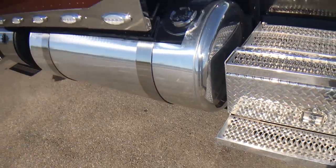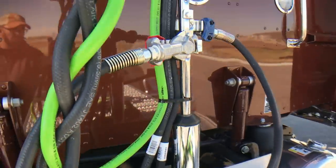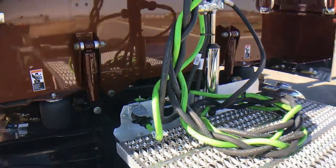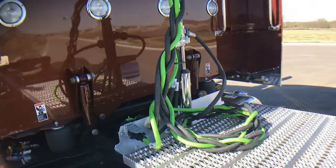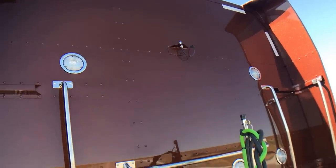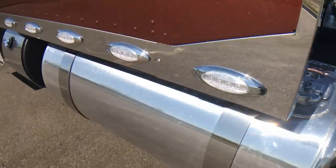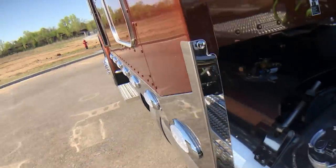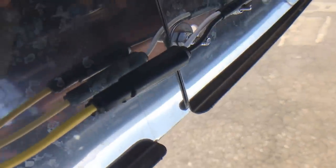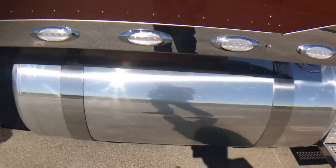This tank is 120 on this side. One of those little things we do: chrome the pogo stick. Dual seven-ways. We've got straight lines on this truck; if you prefer the curly lines we'd be more than happy to swap them out. Six lights in the rear with the antenna moved to the back. It's got the Phoenix LED light kit. As I do all my trucks, it's on a factory harness with all weather-tight seal connectors. You won't find a butt connector or a taped wire anywhere on this truck.